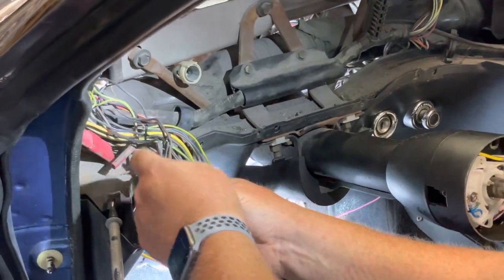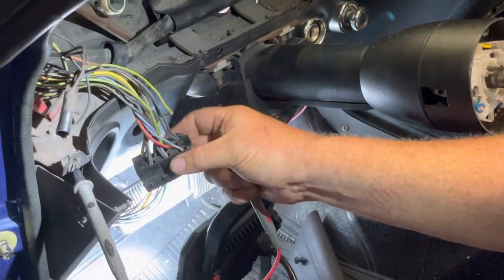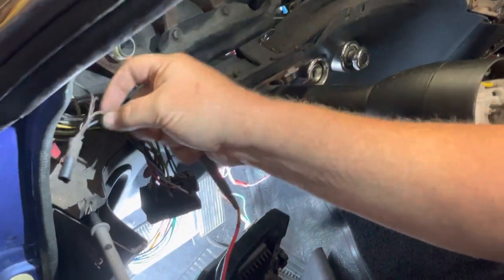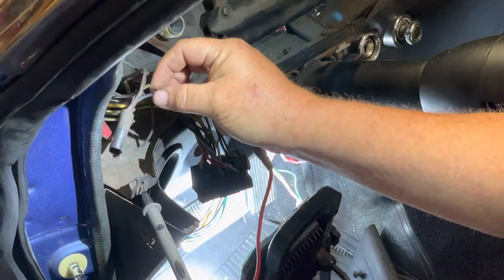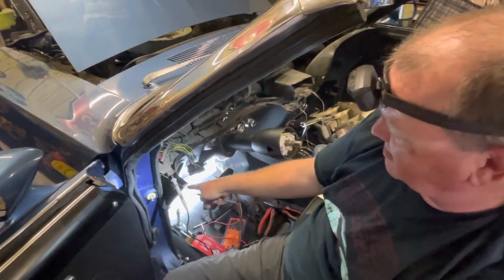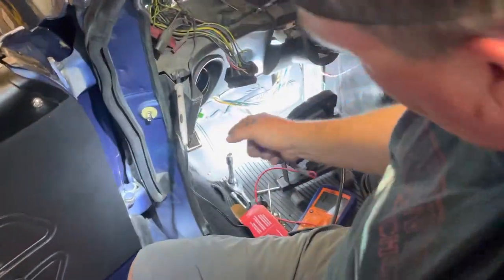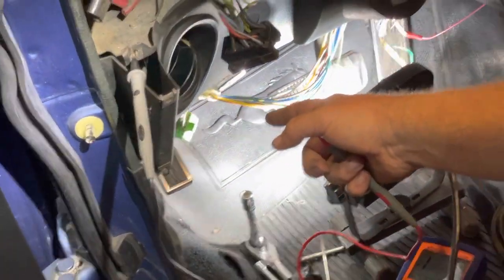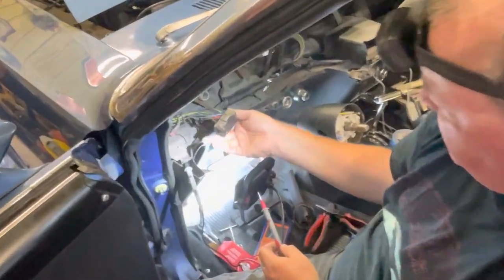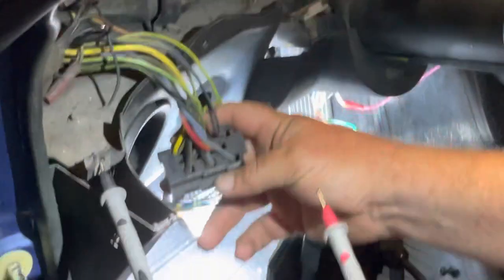So somewhere this is grounded out. This looks like a brown wire and a black wire. This black wire is coming back into the block here; the brown wire is going down to the front side lights. Whenever I touch the block down there under the dash where that brown wire goes in, I have continuity there, and also because it's here it's also grounded.